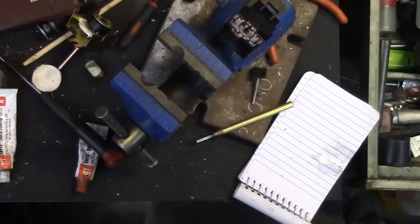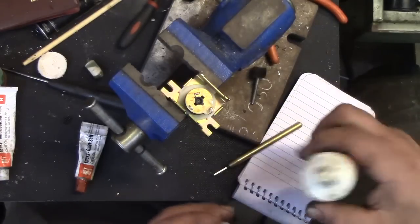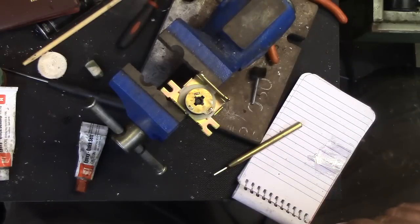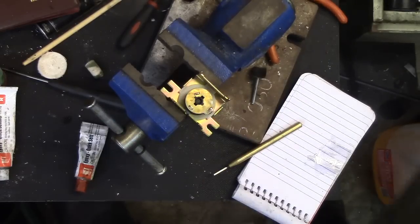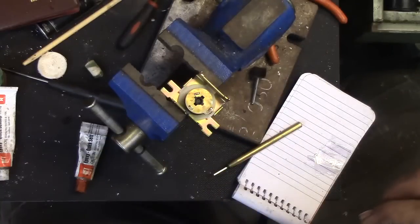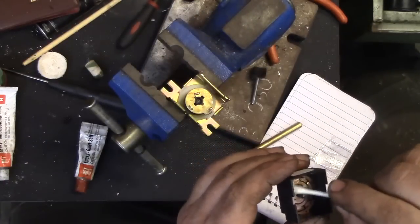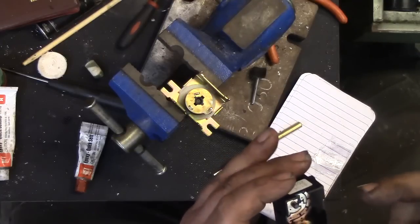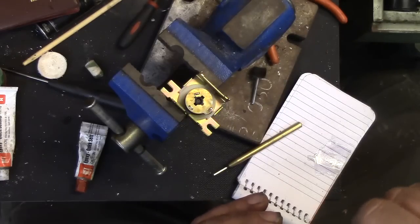Okay, probably a little dab of grease would help. So, silicone grease or a plastic safe grease. I don't want to put any moly or something in there. Okay, you got a notch here for orientation, so that's good. So we're just going to take a little bit of grease. Not much. Hopefully this is the type of grease that takes a long time to gel and get nasty. Actually, I probably should have run it down before putting the lube on. Just a light coat.